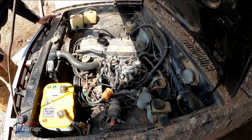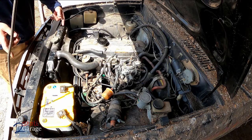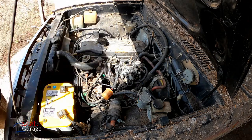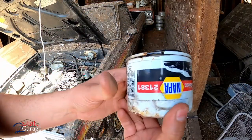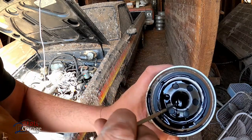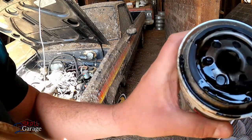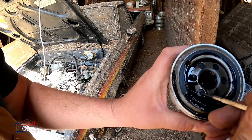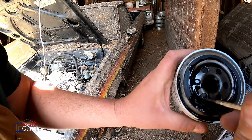I'm going to bring you along for the oil change. I went ahead and took off this NAPA Pro Select filter. Look at this - there's a way in and zero passage out. It's just like a membrane sitting there, not letting any oil through whatsoever.